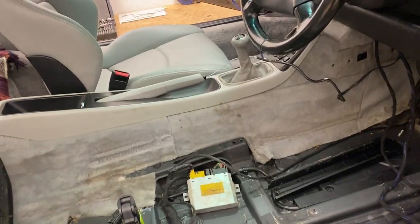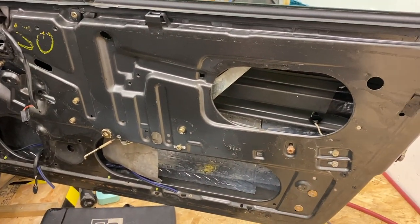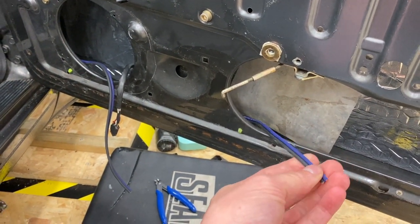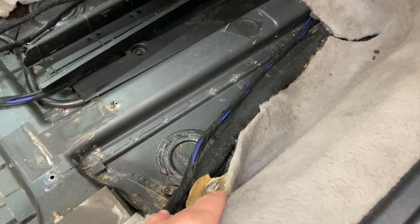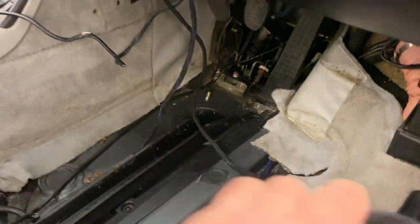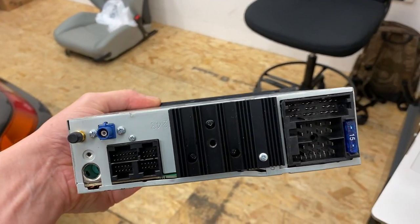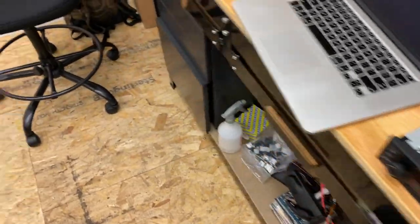It's a couple of days later on the 993 — I haven't taken footage for a bit as I've been going slowly on the install. The doors are all stripped apart and wires for the woofers and tweeters have been run through the door conduit, up under the dash and down under the plastic cover that sits beneath the soundproofing. The feed coming from the Porsche Communications head unit doesn't have any pre-outs or RCA outs, so we're going to have to do high-level speaker integration, which the Audison amp accepts.